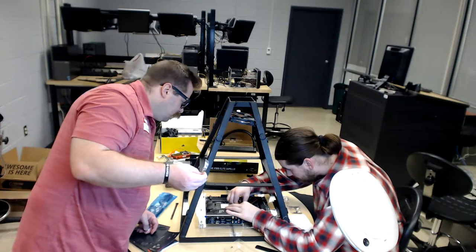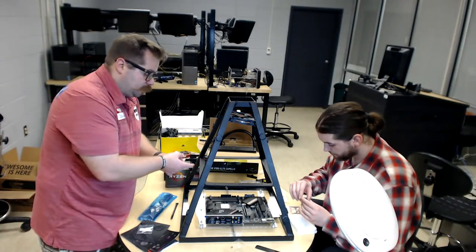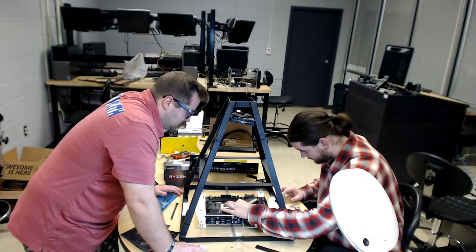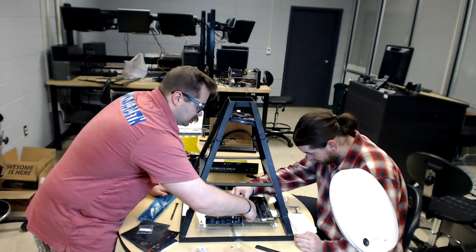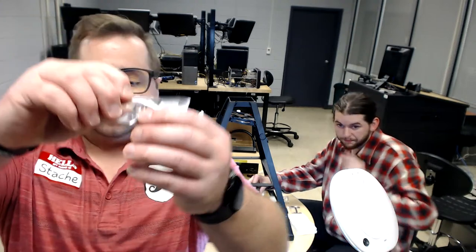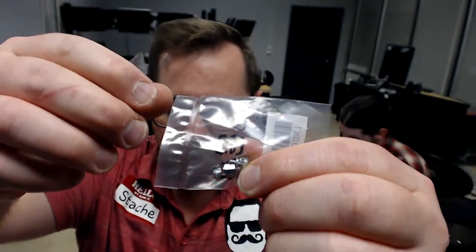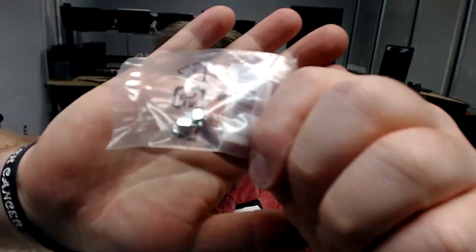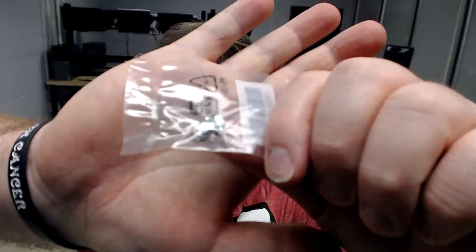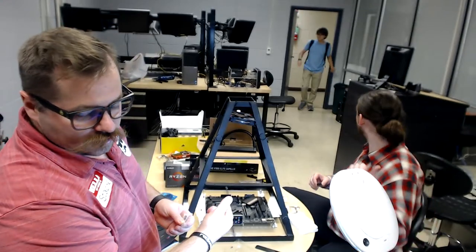Okay. Hold on one sec. So what I want you to notice is, taking it and putting it over like it was going to go in with this M.2 drive, look at the length of it. Notice where you don't have a retention, you don't have this right there. So that's what this is. This is a very small female/male standoff, as well as a tiny screw that you basically... come on thing, you just had it. Yeah, there you go. So that is how you attach the M.2.